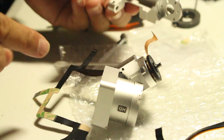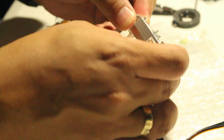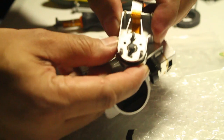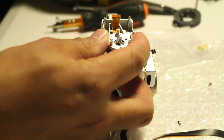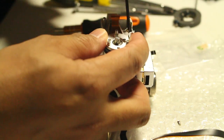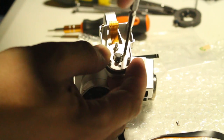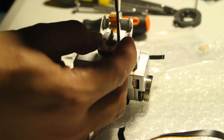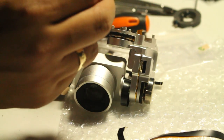Okay, as for the yaw arm, the fixed one, you have to insert this side here. You can just push it, you see, the wires reveal here, and then watch the three holes coincide with the holes on the motor. Screws that you need. So let's magnetize them. Screw it. Also apply thread lock, so in case of vibration, those screws will not loosen.